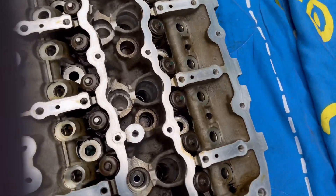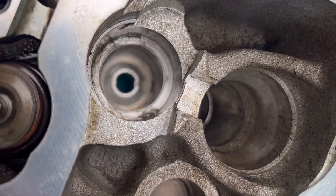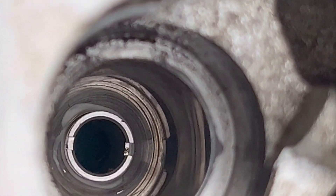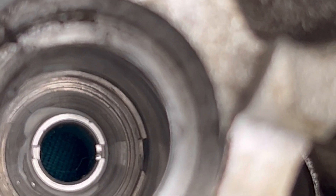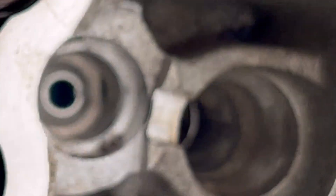It stopped — that's it, I'm done. No extra force. Now we have the insert in. Quick example: notice how one that isn't fully seated has a small gap where it's still poking up — it should sit nice and flush like the one that is properly seated inside the crown. If you find resistance, you might have a little dirt on the threads — it's okay to push past that, just don't keep forcing it beyond where it naturally stops.